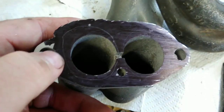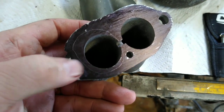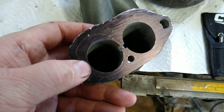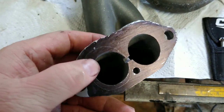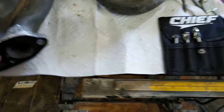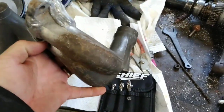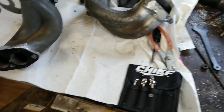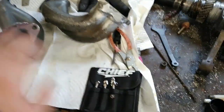When you're porting in this general area where my thumb is, you're not going to try and go all the way through the line all the way up. You're going to maybe make it to the line at the bottom, but you're going to have to taper it in — if not, you will cut through. That one was pretty good. I went a little extra crazy on this one, mostly because when I welded it I did not have the gasket, so I just kept going until I stopped myself.